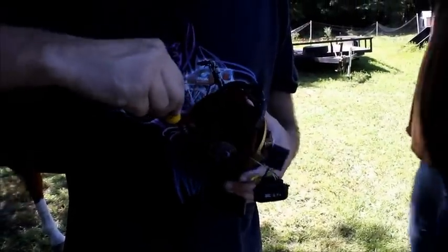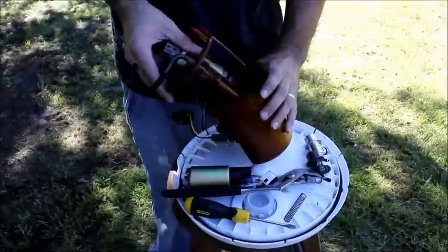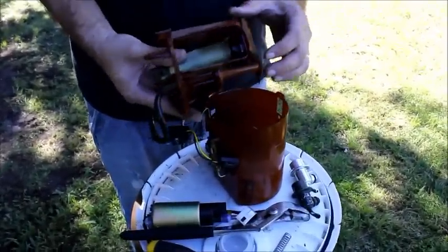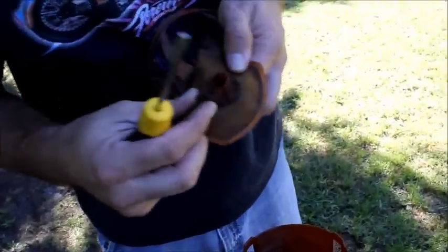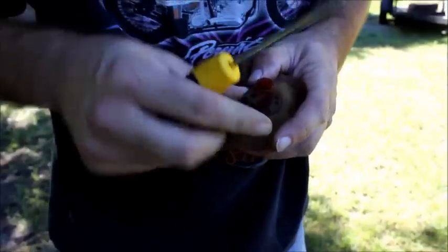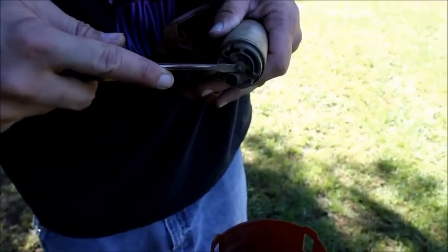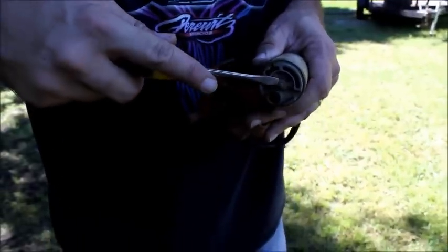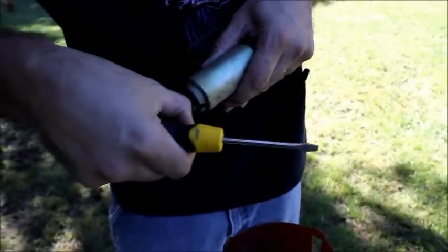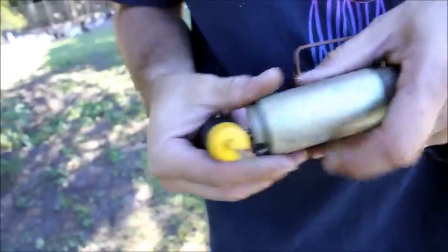Right here is the fuel pump. We need to take this entire top middle assembly out of here. There are three little tabs - one, two, three - all the way around, and then the whole assembly comes out. We have to remove this screen filter. The way this thing comes off, there's actually one of these stupid little round clips in there that connects into here, and that's why we were having trouble. The best point of prying is to get up underneath this and pry it out - it will pop out after a little bit. There's your old fuel pump.